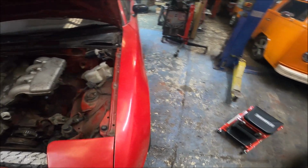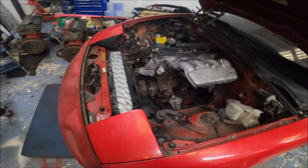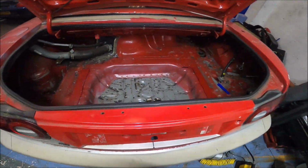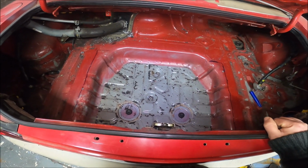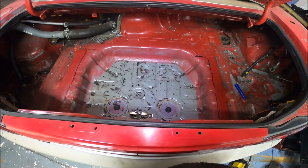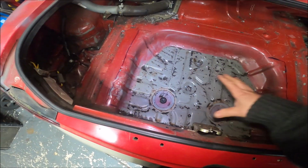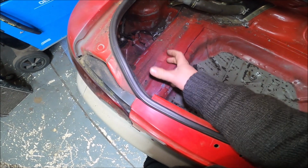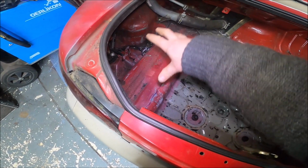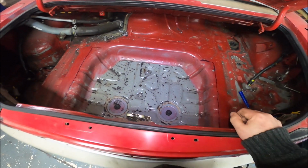And then I spoke to Thomas, and without even half a second's hesitation, he's like, yes, I'll put it in the back. Obviously on Thomas's Silvia and loads of other cars he's built, he's done rear mount. We actually did rear mount on one of mine as well in the past, and yeah, it's fine. So what it's going to do is lie as near as damn it, if not completely flat here, with sort of a header tank, overflow, whatever bit here, so the air doesn't get trapped. The coolant lines will run front to rear, job done.